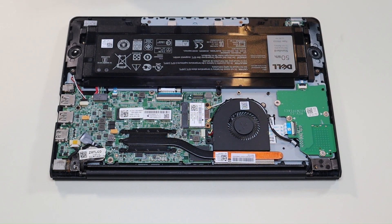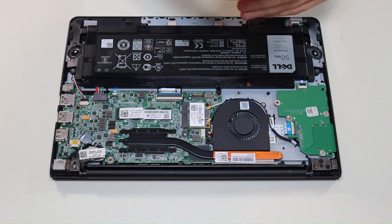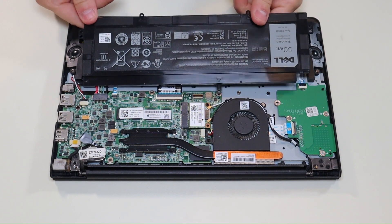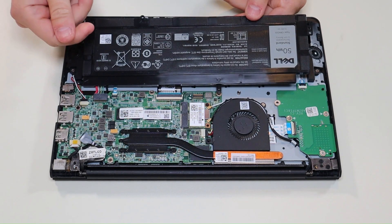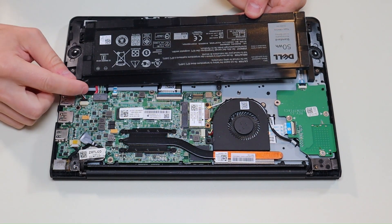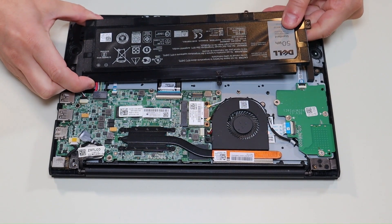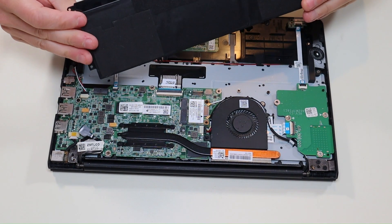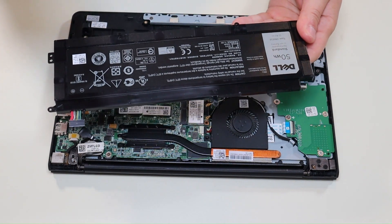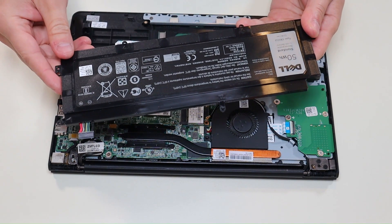Here's your battery down here. It's held in by these two screws on the bottom, this screw in the corner, and this screw on top. After undoing those screws, the battery can come up just a little bit. Even though it's best to never actually pull on the wires when unplugging something — you always want to manipulate the plug and not the wires — this connector is so short and there's no real grip on that plug, so to get the battery out of that port you would have to just slowly, gently wiggle it out. Which is not ideal, but in this computer that's what you have to do. Battery spec information for a replacement will be below in the description, and I'll also have a replacement battery in that parts link.